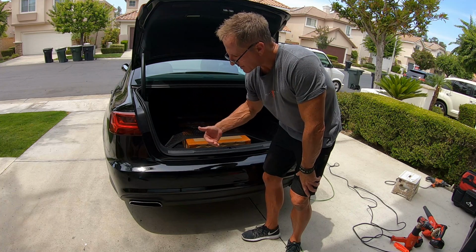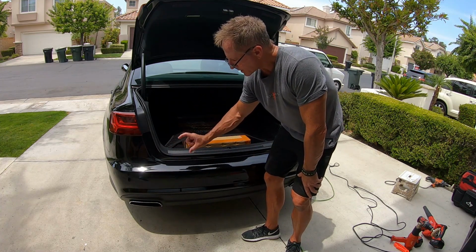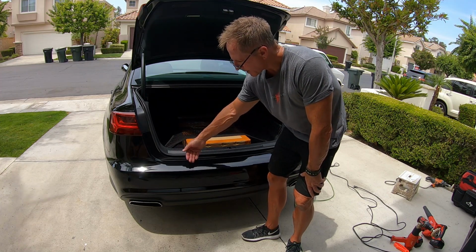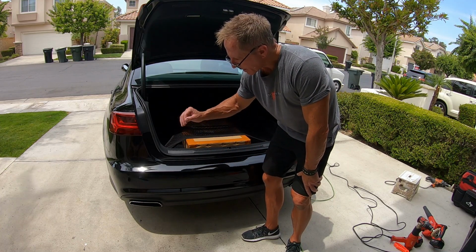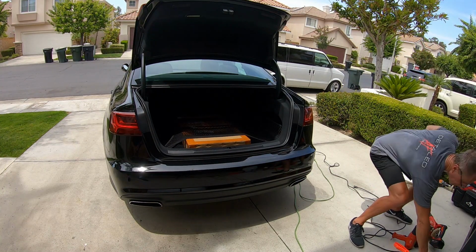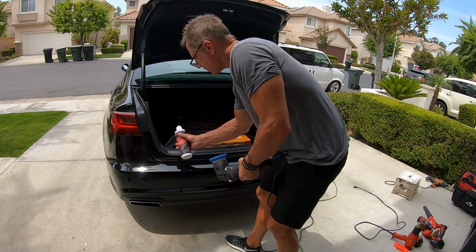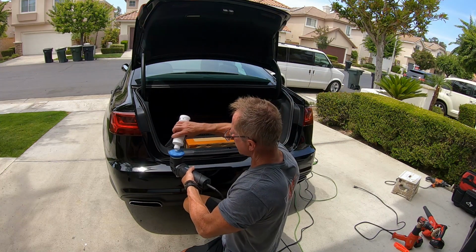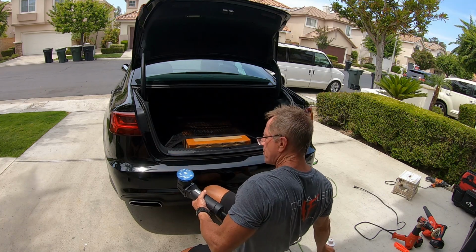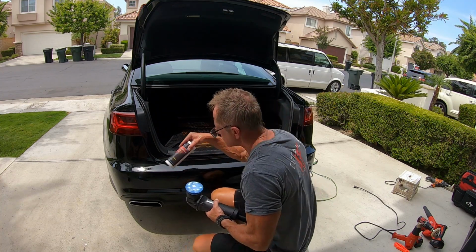So that's the trade-off. It's like, okay, well, I want this perfected more. I'm willing to sacrifice a certain thickness of clear coat, but if you go chasing perfection, that clear coat may become so thin that you actually ruin the integrity of the clear coat. So it's this balancing act. So not every scratch should be removed. I'm going to use my Ceramics single polish product, meaning it will do heavy defect removal down to a swirl-free finish based on the machine, the pad. Those are moving parts I can't control, but you can just use a single polish.